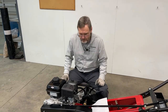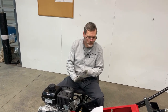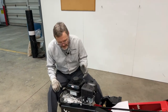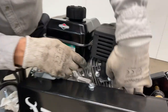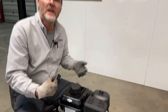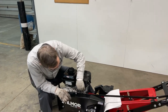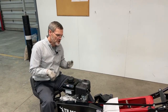Probably one of the first things is cleaning off the machine — you can do it with compressed air, a pressure washer, or a garden hose. Some things to keep in mind: these fins here on the engine are part of the cooling system, so it's important there's not a lot of dust, debris, or mud on those. Being able to clean those off is a good idea.